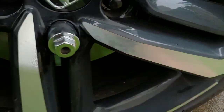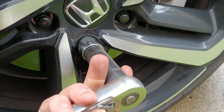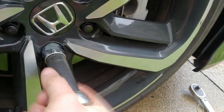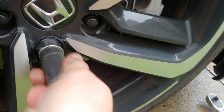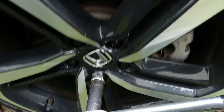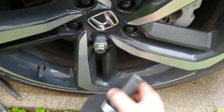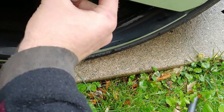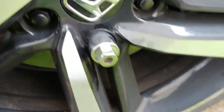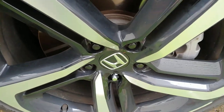First I thread it in by hand, then I grab the tool and line it up — it's a 19mm socket. I spin it by hand first, then tighten it until it gets hard. Once it gets hard, I grab my torque wrench set to 80 foot-pounds. Some of them I can pull the cover out by hand — I put grease on it, so it's a little slippery, but it works and just comes out.